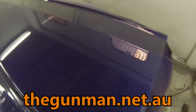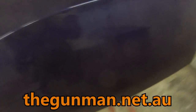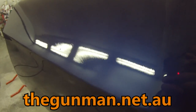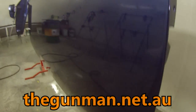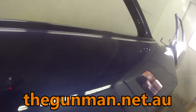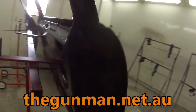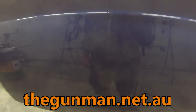Anyway, this is a couple of those panels after being painted - just a little bit of video footage to end the video off with. There was a little bit of dry orange peel up the top of that door, but we just gave it a bit of a sand back - not actually sand it back dead flat, just took the tops off some of those orange peel bits, and there were a few bits of dust there too. This door didn't seem to be so bad, but mainly on the passenger side door it looked a little bit average. But that's painting for you - I was always told when I was an apprentice, as long as you can fix it with a buff, it's okay.